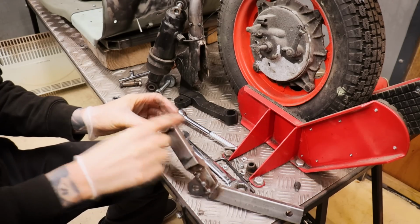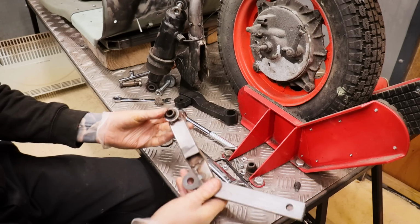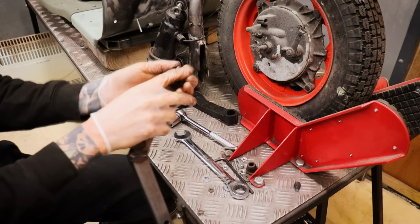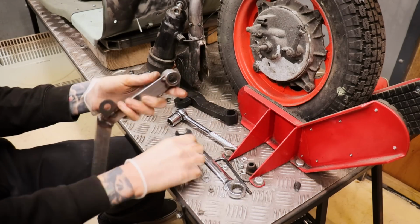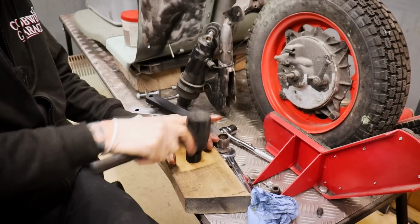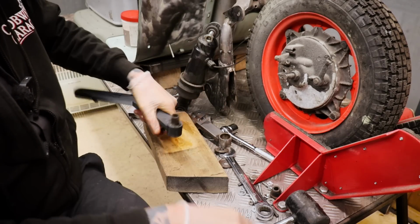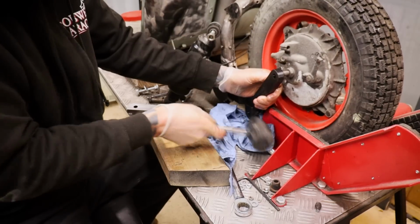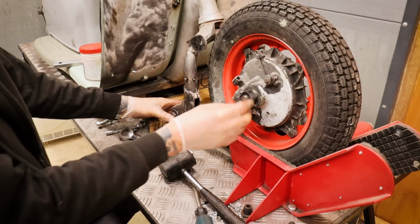So this part of the links I built is actually from the original Slambretta links. These are standard bushes. They've got these cup washer things that go on either side, and that whole thing goes into the forks. So I'm just going to pull out these bushes. Here's the moment of truth. The metal part should fit in again, because obviously that's going in the same. They definitely fit, and it's a super tight fit. Not going to lie, that was pretty tight getting it into position, but it has gone on.